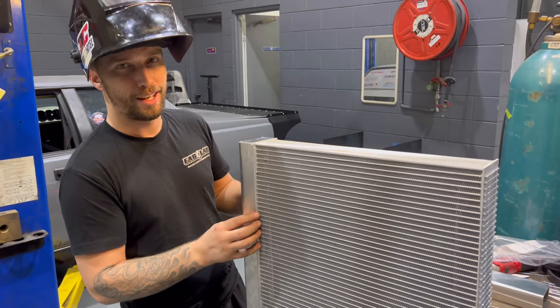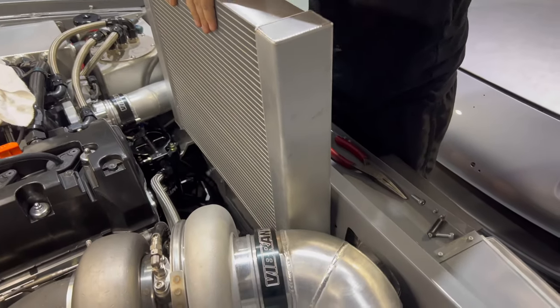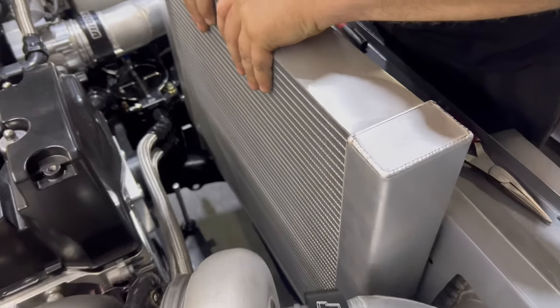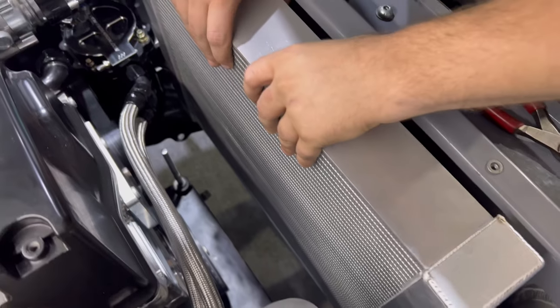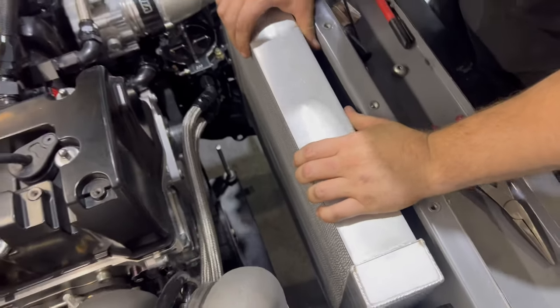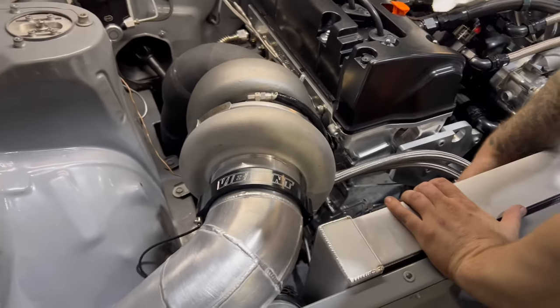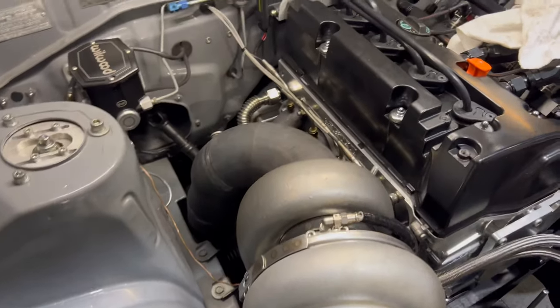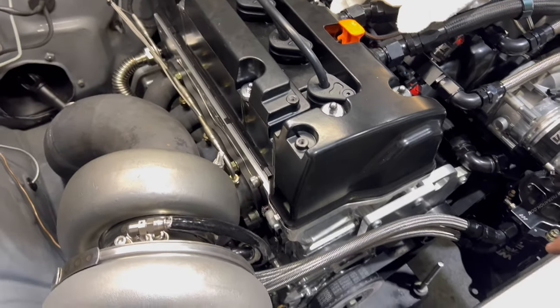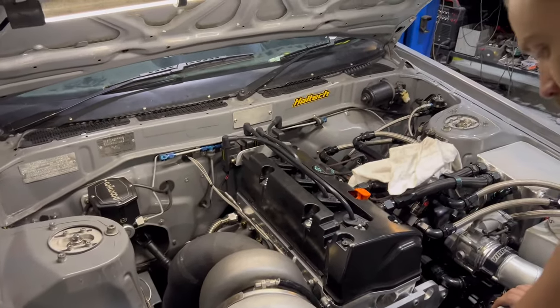It's the last radiator in this car. The test run — do we have faith? It's getting tight this time. Nah, we're good — 5mm but we're good. Man, we've definitely lost a lot of room at the front of the motor — that's because we pulled it forward 60mm. So it's always going to happen — just to stop our wheelie problems. I really hope it does help.